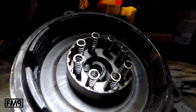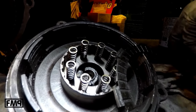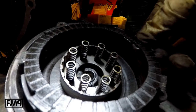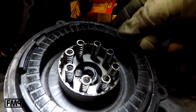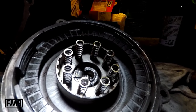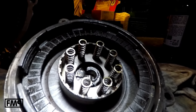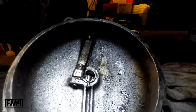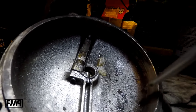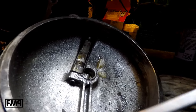Just a standard basket — it's original with a slight old tuning, so no need for strengthening it. So what we are doing now is, even though it's not a strengthened clutch basket, we are going to work on the clutch lid. We are going to widen this diameter, put away some material, and remove this beam.